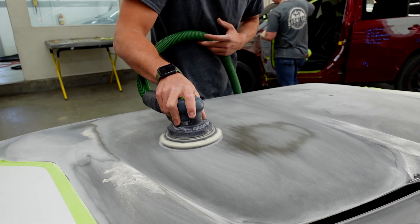We've got this thing all sanded down and prepped up for painting. As you probably could already tell, the edge of this hood is painted white to match the rest of the car, with the carbon fiber in the center — which is very unique to see from a manufacturer, but it's a pretty cool look. The resin was flaking away at the edge of the white paint, so if you come in closer, you can see where we actually had to sand away some of this white. What we're going to do is first mask this off and recreate that line, and then remove the masking tape and re-clear coat the whole thing.